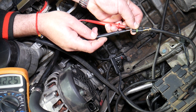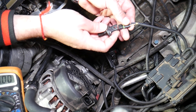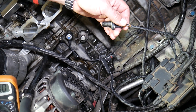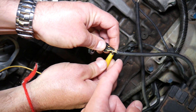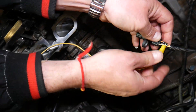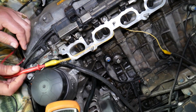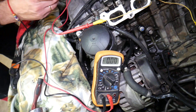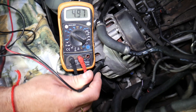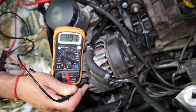Now it's recommended to turn the ignition switch off and reconnect the sensor. We have the signal wire exposed, but there is a special device you can use to clamp onto it so you don't have to cut the wire open. We're going to connect the alligator clip to that wire and connect the red lead to the alligator clip — that way it's like touching the lead to the signal wire itself. Then apply the black ground lead anywhere on the engine and you should get about 5 volts.